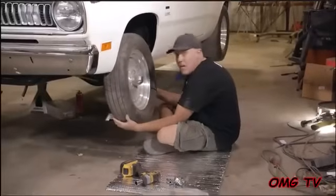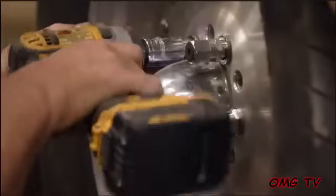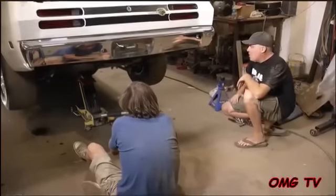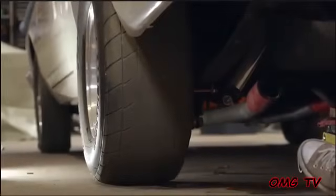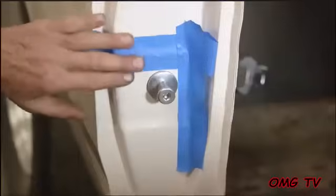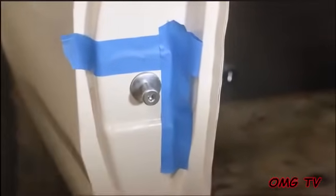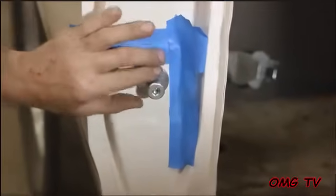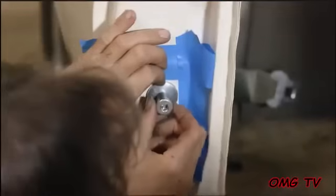We're finally going to put the wheels and tires back on and drop this thing on the ground. Let her down for the first time in a long time. When the car was up on jack stands it actually flexed so much that we couldn't adjust the doors, but now it's on the ground. I'm going to install new strikers and then we're going to get into making them work right. I'm adjusting the striker pin — if it's misaligned it can actually blow out the door jamb area, especially on these A-body Mopars. I lined up the height with the latch and eyeballed it, then took a guess at in and out. It proved a little too far in, so I set some guide tape pieces for reference and moved it out a little bit.